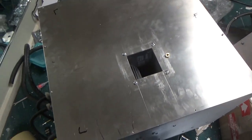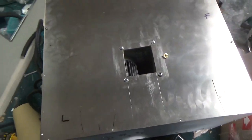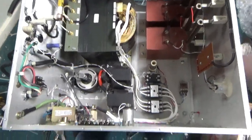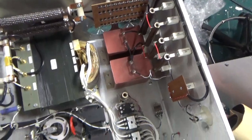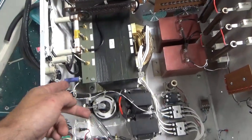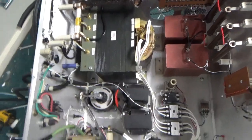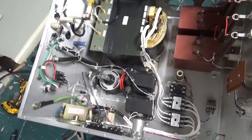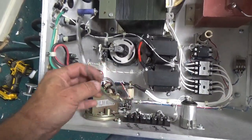I'm going to pull this off, do the screws, pull it off and I'll show you the inside. Okay, so here's the inside. I vacuumed — I still need to come in here with a little brush to get the stuff out in the areas I can't reach with my vacuum nozzle, but it looks pretty good. You got the pressure interlock switch with the tubing coming off of it.